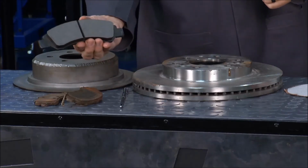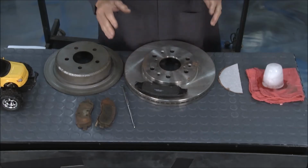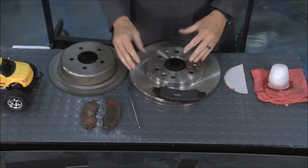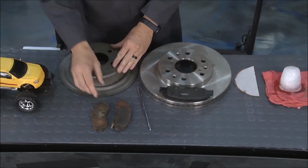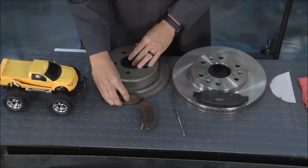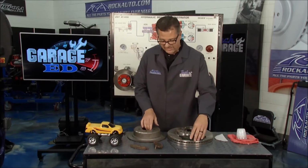We've got a nice brake pad and a nice rotor. You put that on there. When you apply that pressure, those brake physics, the kinetic energy turns into static motion. It starts to stop. You dissipate heat. This is a high coefficient of friction. Come over here to our rotor assembly with our worn out pads or no material at all. Man, that's a low coefficient of friction. It's never going to stop. Not to mention the heat dissipation itself.